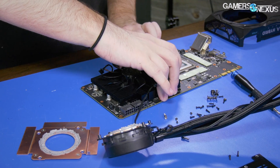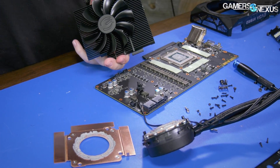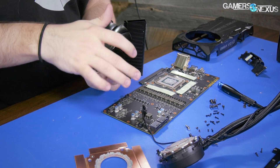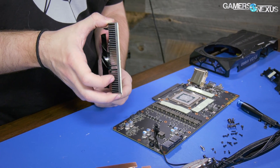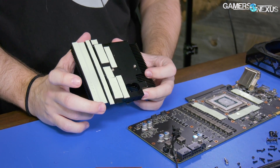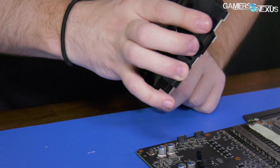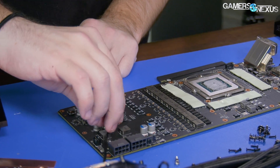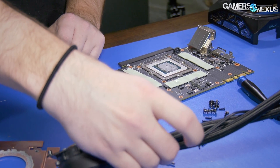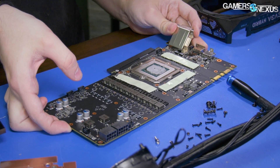Let's pull off the VRAM heat sink. That is a gigantic VRAM heat sink. There's your fan - back swept fan blade design - and a pretty densely packed set of aluminum fins. This should be a pretty good thermal performer; we'll test it at some point. Cap cutouts, and everything else is directly contacted by a ton of thermal pads, as EVGA has done lately. Somewhat of an overcompensation, yes, but given what they went through in terms of controversy with ACX, it's probably better to do that kind of response to show that they did listen. Can't really blame them for making a better product for their high end.